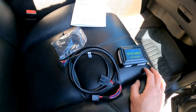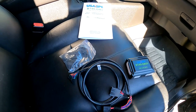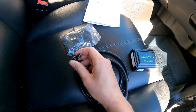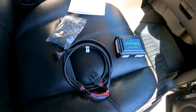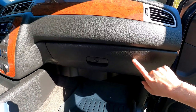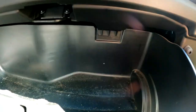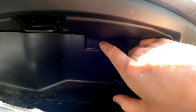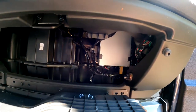This is going in a 2008 Chevy Tahoe and it will also be going into a 2010 Cadillac Escalade. These are the wiring harnesses we're gonna hook up, and then we're gonna run the microphone up into where the sunroof controls are. First, the XM receiver is behind the glove box, so you wanna take the glove box down. There's a tab inside that holds the glove box lid up — push that tab so the glove box slides past it and falls down.